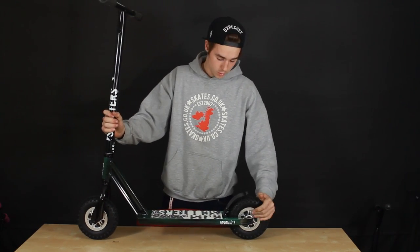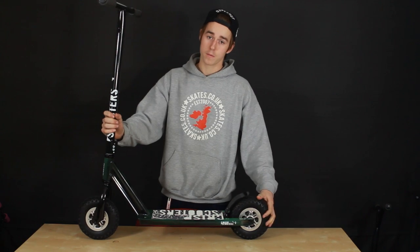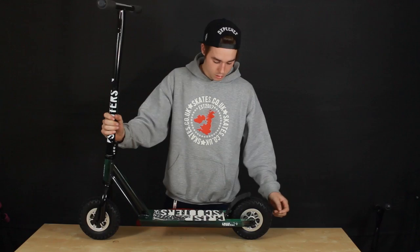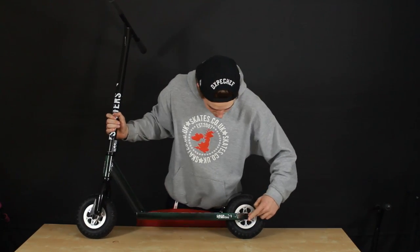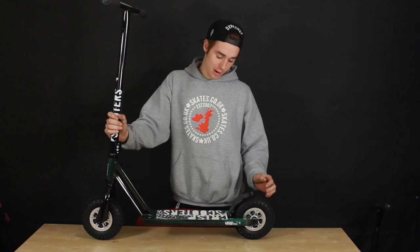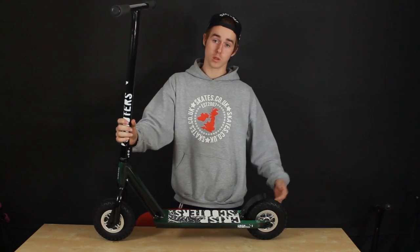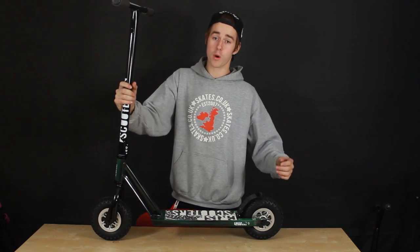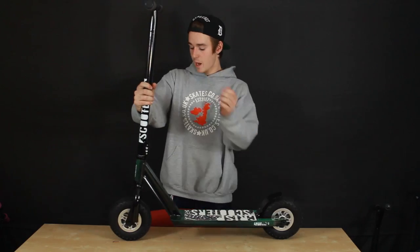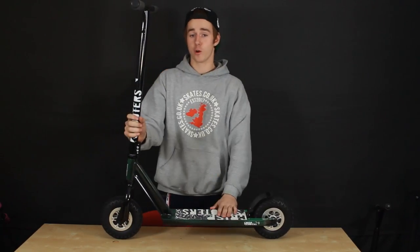On the back you've got the same — a nice good wheel, full CNC'd alloy, and the stock tyre is great. Fully bolted on with 8mm axles, so they're not going to bend. On the other side you've got a nylon-threaded bolt, so you're not going to lose it — the axle's not going to come off or come loose. It's a really sturdy axle to have in your scooter. You don't want anything smaller than that if you're taking it off road and giving it a beating.